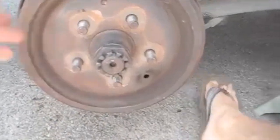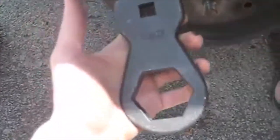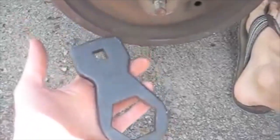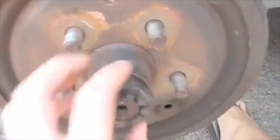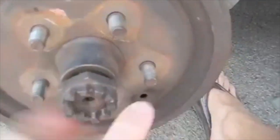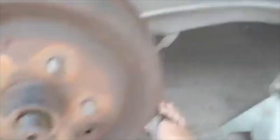Pull off your wheel — this is a 46 millimeter. I got this guy and my breaker bar and a length of pipe to go around the breaker bar. Getting it back on may be a different story. This guy comes off and then the hub. Definitely want to turn off your parking brake, chalk everything, get your stands there, and then this should just come off.